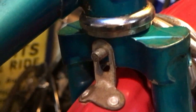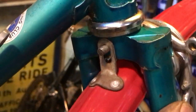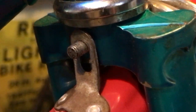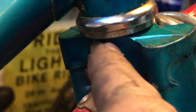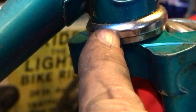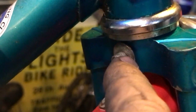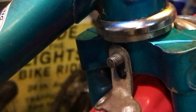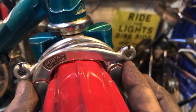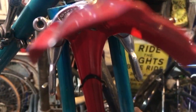The shaped washer here is not just decorative — it helps to clamp the brake securely and flatly against a flat surface, which avoids vibration and squeaking. At the back, if I need more tyre clearance and push the mudguard up, it can foul the headset. I've seen these mounted where the top of the bracket is rubbing against the bottom crown race inducing friction — something to watch out for. You can bend the top of the bracket back if necessary. Of course we take care to mount the brake perfectly centrally.